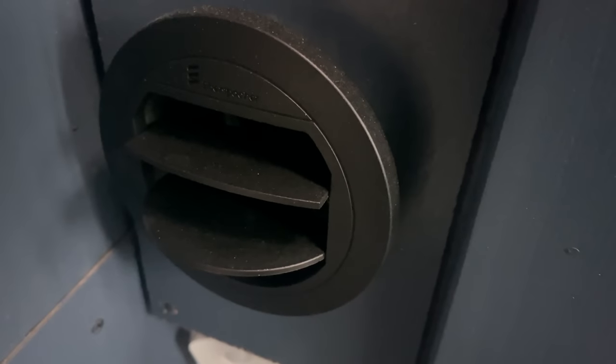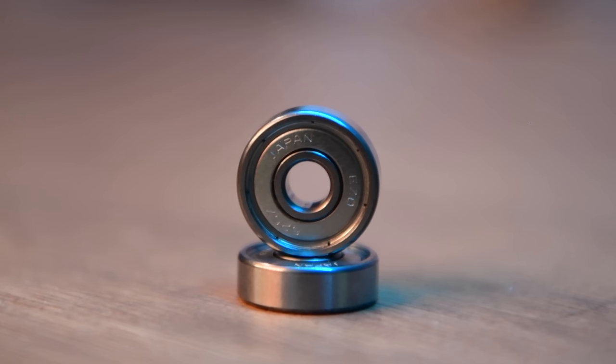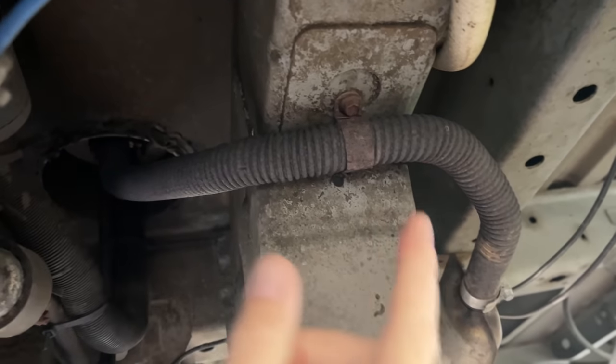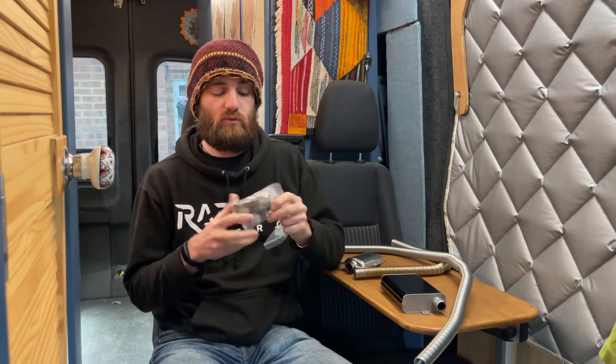The reason I'm doing a service now is the bearings for the fan motor are sounding a bit crap and scraping. It's getting progressively worse so I'm going to replace them - I've spent about three pounds per bearing on some Japanese-made high quality bearings. Another thing I'm doing is replacing the original stainless steel Chinese-made exhaust, which has pretty much rusted through, with some nice Webasto brand exhaust. On top of that I'm replacing the original cheap jubilee clips with some proper exhaust clips.